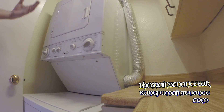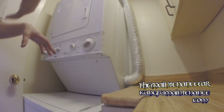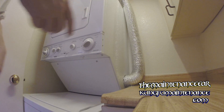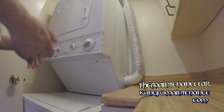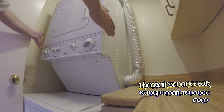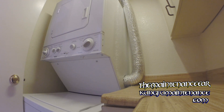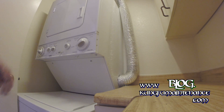So once again, the difference: with 110 voltage, the dryer motor coils will have more windings, more copper windings — and that copper adds to the cost of the dryer itself. So a 220 volt dryer is cheaper. That's the story on 220 versus 110 dryers. Of course, 220 dryers will be wired differently and you'll need a different, larger plug outlet for the 220 volt.